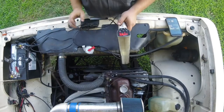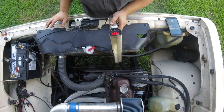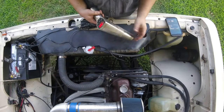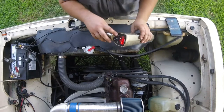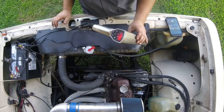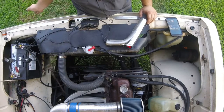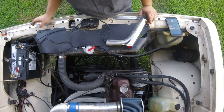That's pretty neat. This is actually one of my favorite tools, because you can make an engine run very differently just by using the timing light and adjusting the timing. I can also use the tach here to set up governor RPM and stuff like that on lawn mowers, and you can set up your top end RPMs for chainsaws and weed eaters and stuff like that. So that's pretty neat.